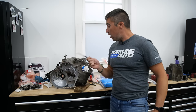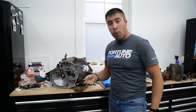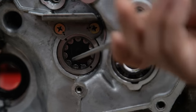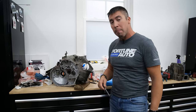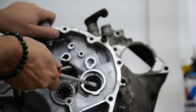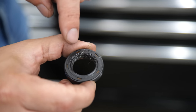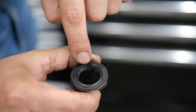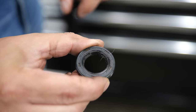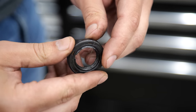Now that we've got the gears and bearings on the countershaft and main shaft done, we're going to focus on replacing the remaining bearings, and then we can start putting the transmission back together. It's a good thing we popped this open because the seal was on its way out — there's a crack right here, pieces of rubber missing, and it's very hard and not pliable. Good thing we're replacing it.